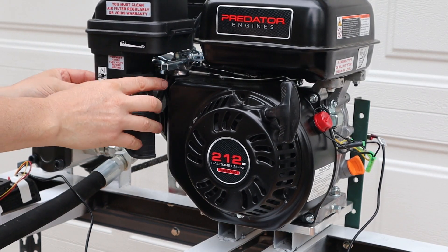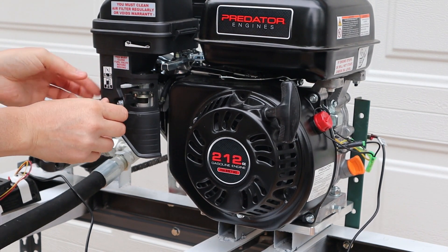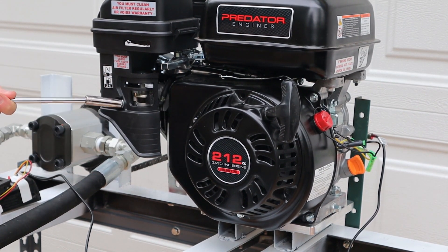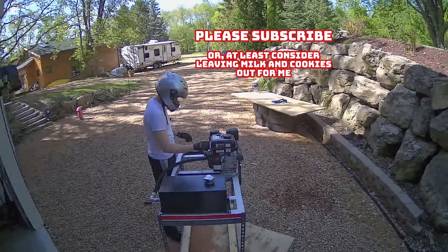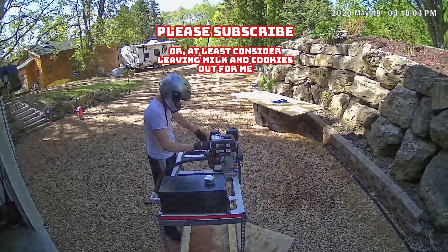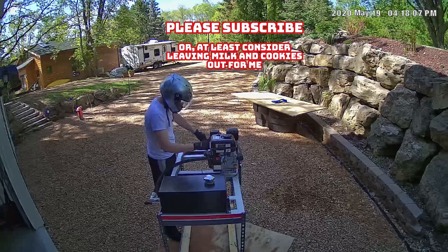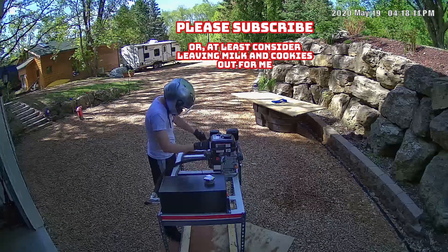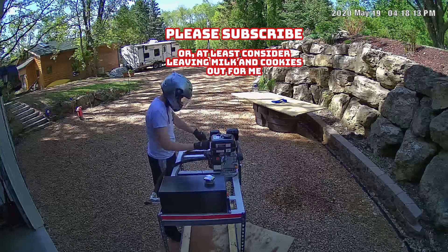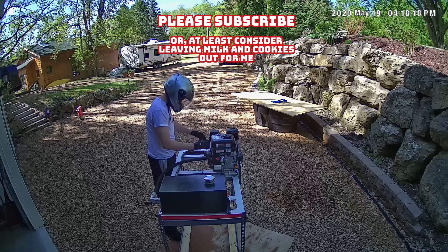I put the stock carb back on and was getting 7.2 horsepower at 4,200 RPMs on a hot engine — a little deviation that was expected at this point since I was playing with it for a while. I maxed at 4,500 RPM, which was a little odd, although I did add a chain stabilizer or a skateboard wheel to my dyno that might be the culprit, or it wasn't just the linkage shifting from switching these back and forth. The horsepower was consistent, however, and it was a nice result for torque gain.